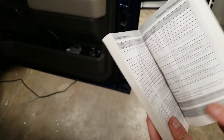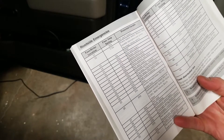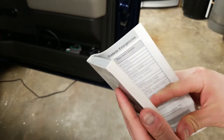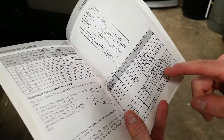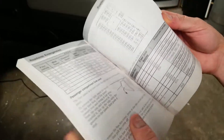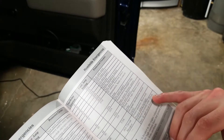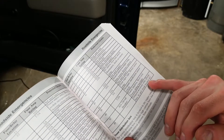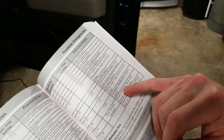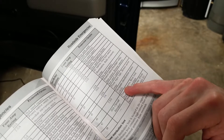The first step is to find which fuses are ignition-controlled and which are always connected to 12 volts, if you're not going directly to the battery. This is typically in the manual, so open it up and look at which fuses are ignition-controlled or always on. For the ignition-controlled fuse, choose something non-essential so that if it becomes disconnected it won't create a safety hazard. Test it by putting the multimeter across it — confirm zero volts with the ignition off, then turn it on and confirm 12 volts.